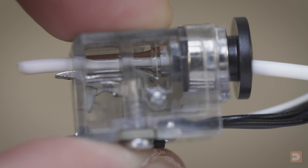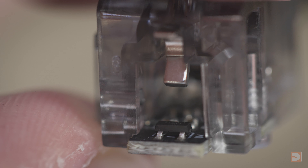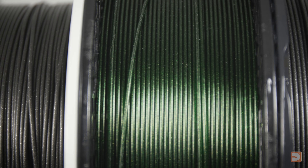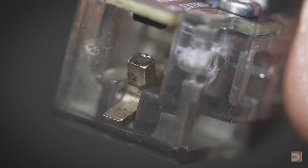The sensor features a magnet on a lever which is pushed aside as filament enters the extruder. If you regularly print with materials such as Prusament Galaxy or Bambu Lab Sparkle, tiny metallic flecks which give these filaments their speckled shine can get attracted to the magnet in the sensor. When I found that mine was absolutely caked in black and silver sparkles, I grabbed a non-metallic soft bristle brush to clean it off. This is that sensor after cleaning, and it's still not looking pristine.